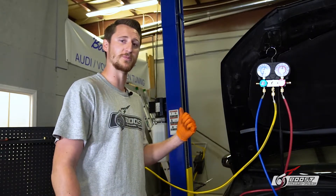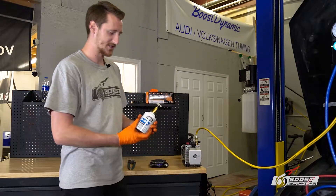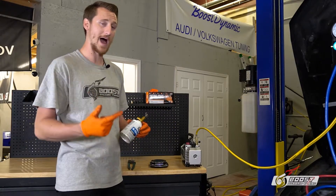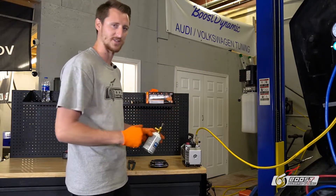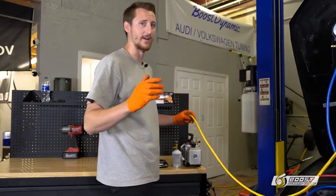It's time to put some refrigerant in the AC unit. We need to set up this canister because this is our refrigerant. We need to get it in there — you can see we have this line hooked up, which was used to put the system in a vacuum. Now we're going to use that vacuum to pull this refrigerant in. You'll need a special adapter, and the gauges should come with the lines you need. Both valves are shut — double-check because you don't want air coming in.